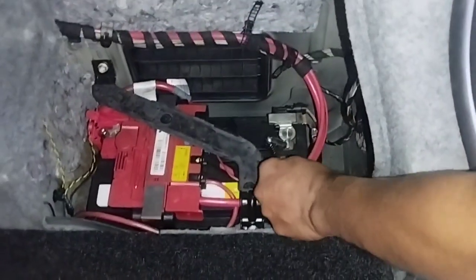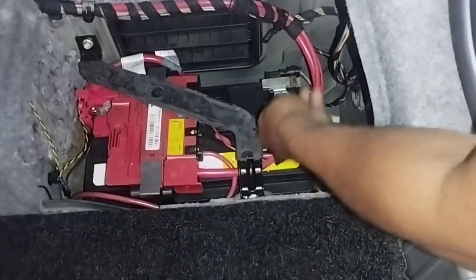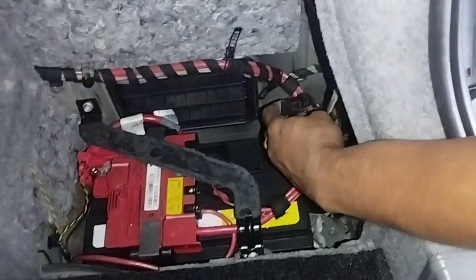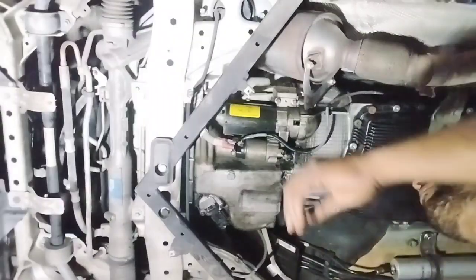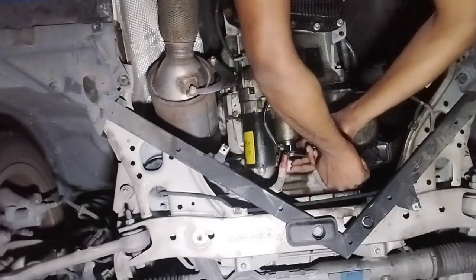There is no problem with this car's wiring, so to change the starter, first disconnect the battery head cable connection. Remember that if you don't open the battery connection to change the starter of your car, the starter has a positive connection and a negative connection on the engine body of the car, so if it touches the wire and the body, the connection will be broken by fire.